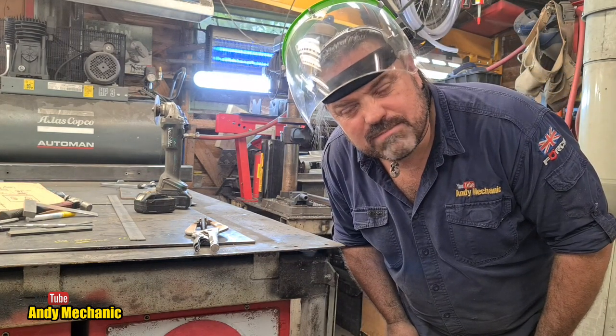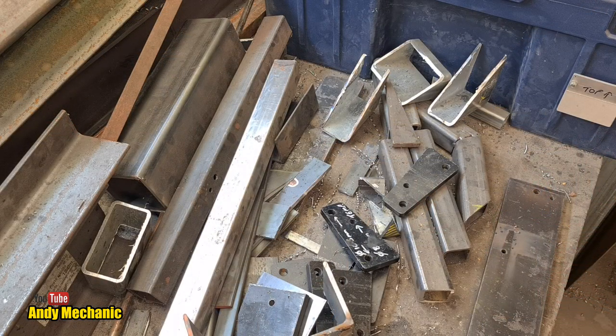Decided to change the design a little bit. This usually happens. Okay, great idea to use two pieces of steel, so we only have to cut the slot in one of them, the top one, and the bottom one only has a hole drilled in it for the actual nipple diameter. But there's nothing to stop the cable jumping out from the top. That would be bad. So why not use three pieces of steel? The middle one has the slot for the cable, and we can just sandwich the nipple in between it, put the two plates on top and bottom that have only got the hole drilled, and sandwich the whole thing together. That way, there is absolutely no way the cable can jump out. Plan C! Excellent! Let's crack on! Yeah, we won't be needing that piece.